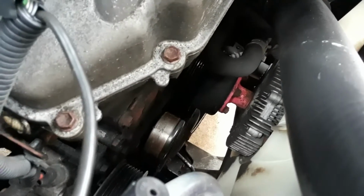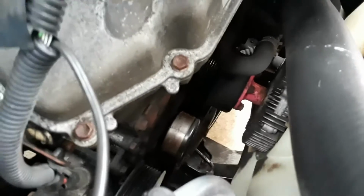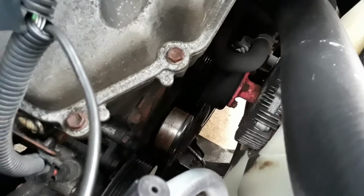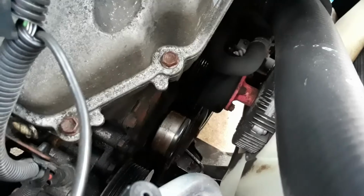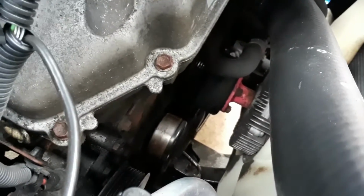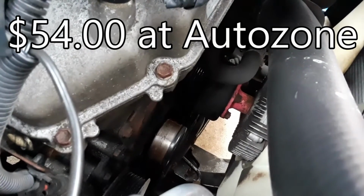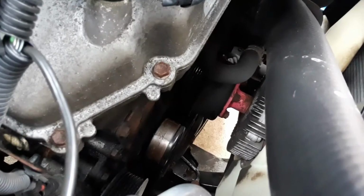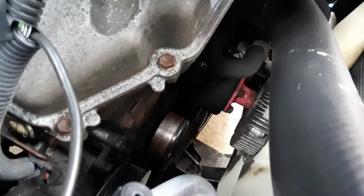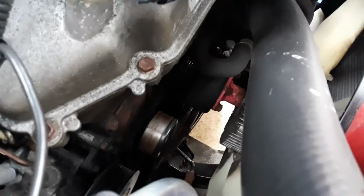But anyway, yeah, for $1.20, I was able to replace that bearing just in the idler pulley versus a minimum of $15, or as high as, I think I saw one for $35 for that same idler pulley. And you know, now I did spend $12, but I've got nine additional bearings for future use. So just something to keep in mind if you replace, and that's not just for these idlers.